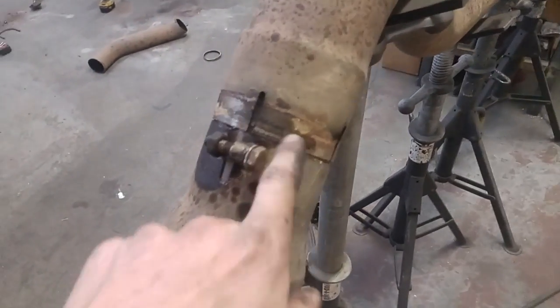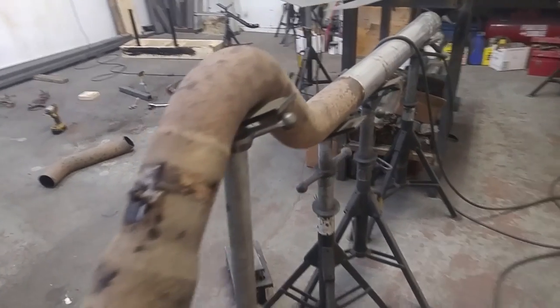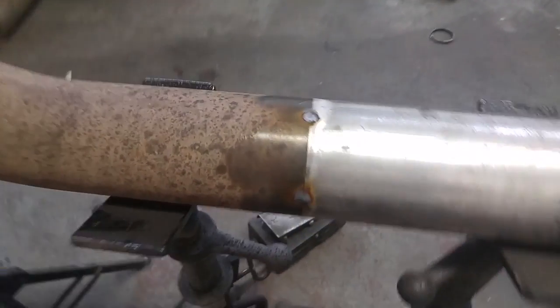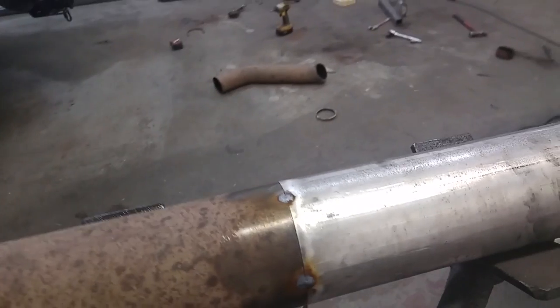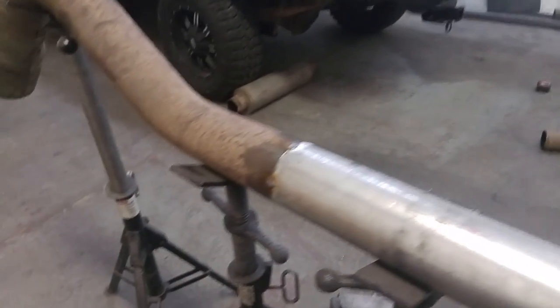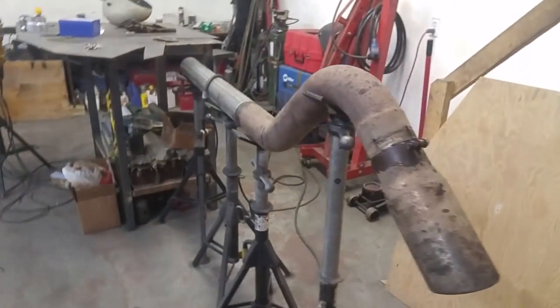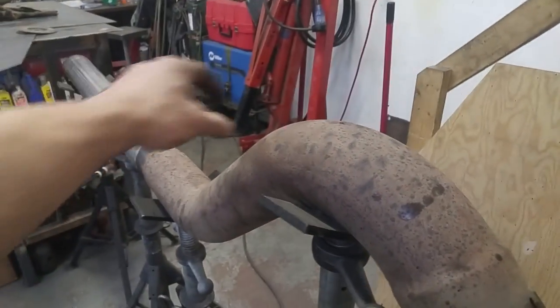I got this tip slammed on here - just bashed it on there as far as it could go, right to the end. And I can just clamp it - doesn't even need to be clamped, but yeah, just clamp it and it's good to go. I figured out how long I needed the pipe, cut it, and tacked it up. You can see it's zero gap anywhere, because a really thin pipe is tricky to weld if there's a bunch of gap - trust me. You definitely want to use a TIG welder or something, because you can do it with stick but it's a pain. So I'm just about to put that underneath now, give it a test fit and see how it looks, and then I'll have to build some brackets to hold it up.